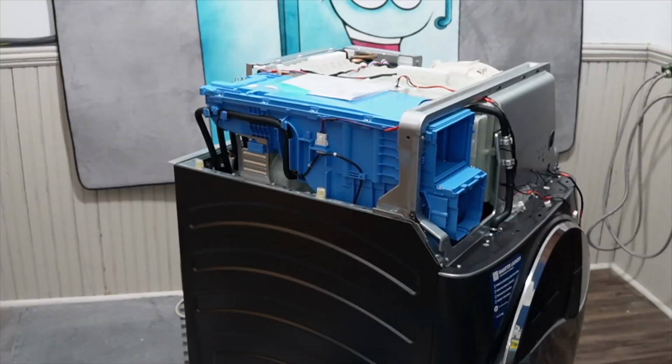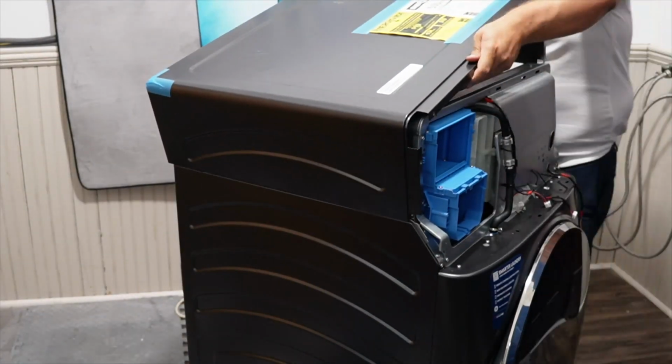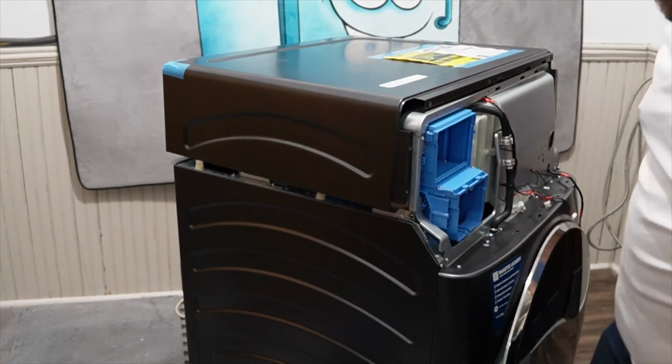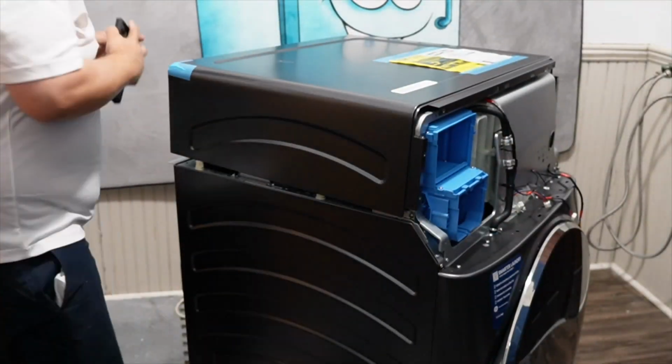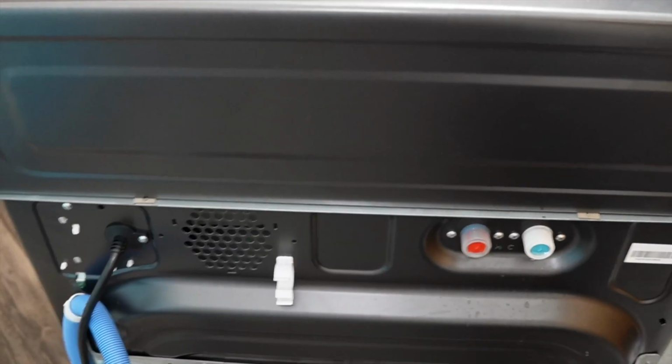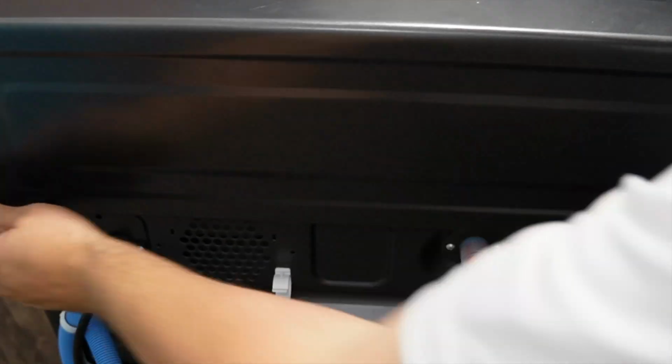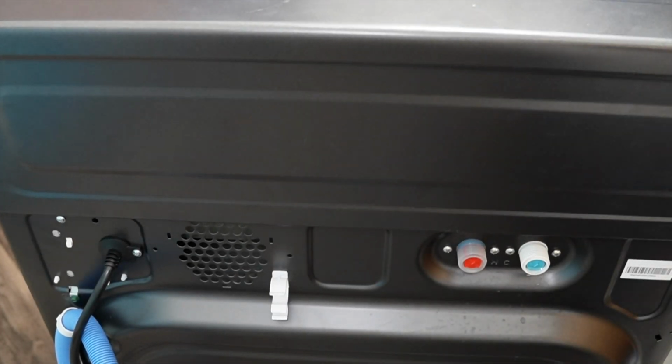With the heat shield on, the top of the entire washing machine assembly can go back on. Make sure to seat it around the edges so that it sits on the 4 plastic pegs that are around the edges of the washer chassis. Once you have those pegs slotted into place with the top, pull the unit backwards and it should become flush with the machine like you see here.